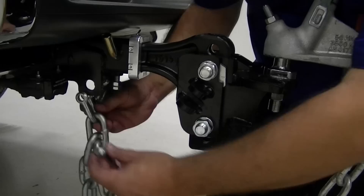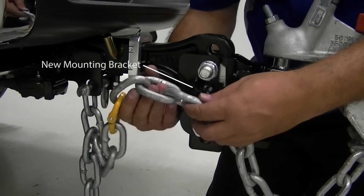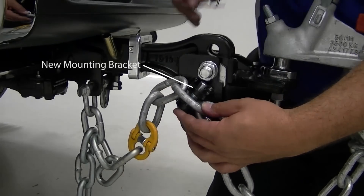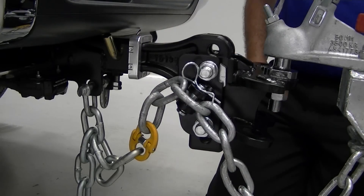the chain can be connected to the vehicle's existing mounting points and the new mounting bracket, providing a suitable and safe solution. You can adjust the length of the chain by changing the link that attaches to the chain. Just make sure the caravan or trailer manoeuvrability isn't restricted when doing this.